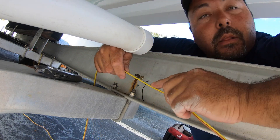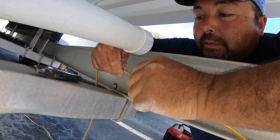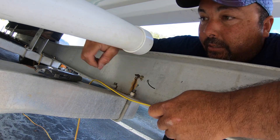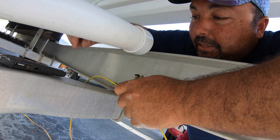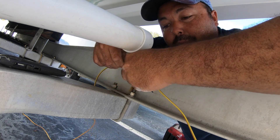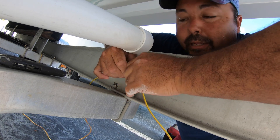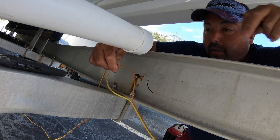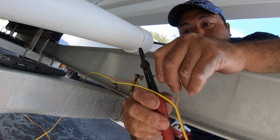We're on the port side of the trailer, so we have the yellow wire and the brown wire. This first indicator marker is going to be a running light, so it's going to be the brown wire. I've got to split it and separate it from the yellow wire. Be careful not to cut into the other wire. I like to give it just a little bit of slack so down the road — a year down the road — I'm going to have to replace this light again. I got the brown wire, which is the running lights wire, and I'm going to cut that and splice each end.